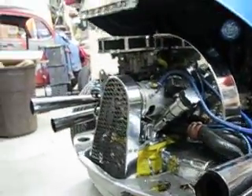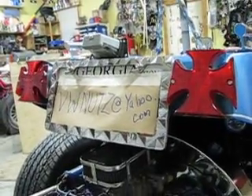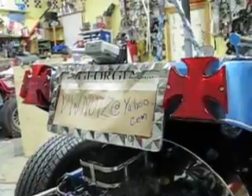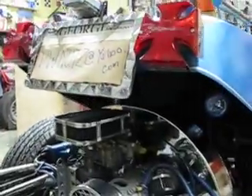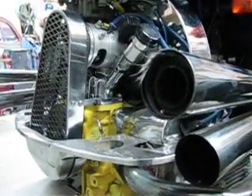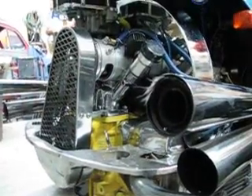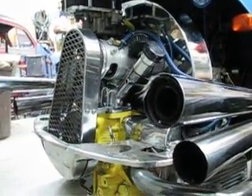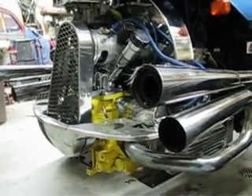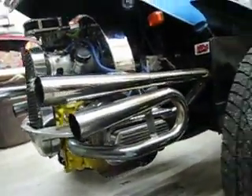Maltese tail lights — very cool. Those are your tail and brake lights right there, and your turn signals are up underneath. I ran this machine quite a bit with the baffles out — you can see I've got them pop-riveted in there, just run an eighth-inch drill bit through there and drop them right out. It sounds like a hot rod V8; people ask me all the time what kind of engine I've got on this machine.